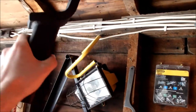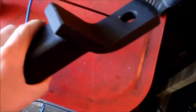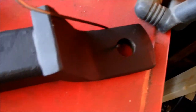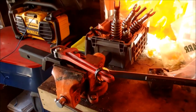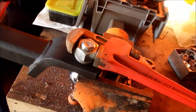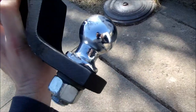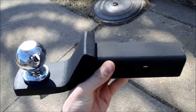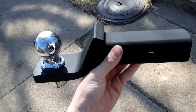Then prime it and paint it with undercoating. After the coating of rust reformer and some undercoating, here's what it looks like. Adding leverage with my big wrench here — I really need two hands to do this, but you get the idea. And there is our finished product all ready to put in the truck. Much better than that rusty piece of crap I had with the dinged up ball.